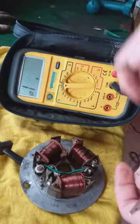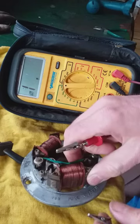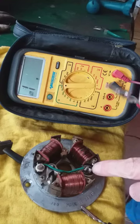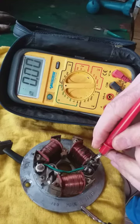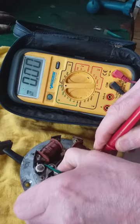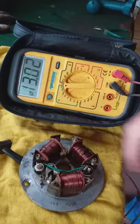The same goes if I test the capacitor that's on the bike just like this one — you won't get a reading. You have to have it detached from the soldering here. If I put that on there now I get a strange reading that means nothing. Even if I open or close the points it makes no difference. So you can't test them on the bike unless you detach them.